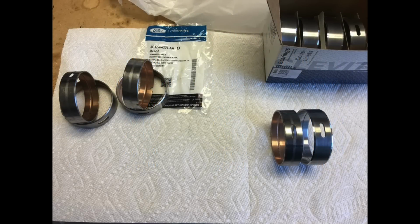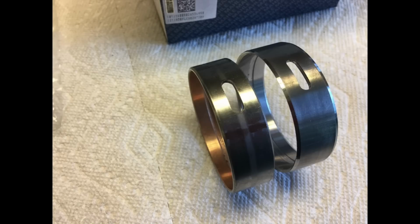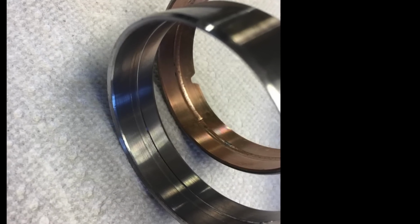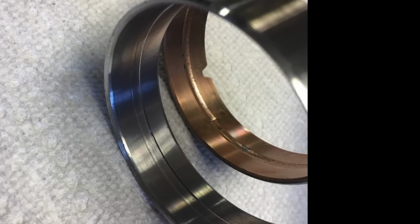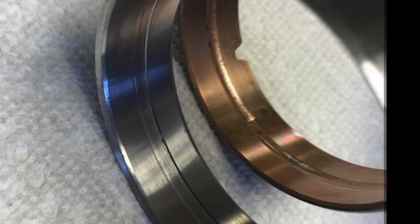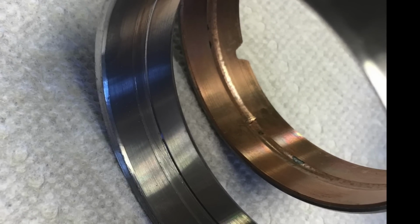I purchased both Navistar OE and Clevite bearings. The companies use different technologies and designs. The oil inlet ports are the same width and length. Navistar uses what appears to be bronze, while Clevite uses an aluminum coating as they state in their literature. Clevite's oil channel is not as deep, but it's broader. Probably the same flow volume, but slightly less bearing surface. Not really enough to matter.